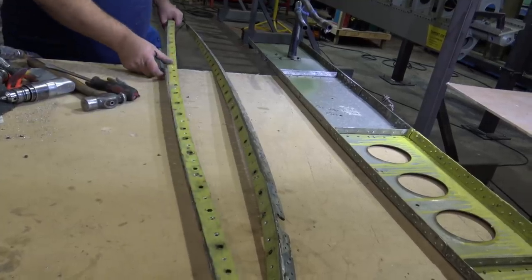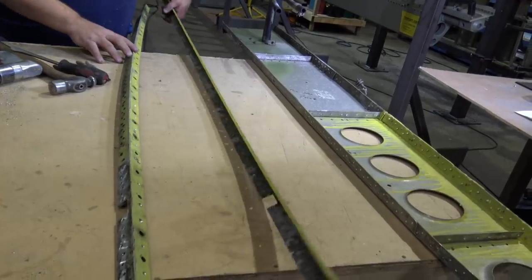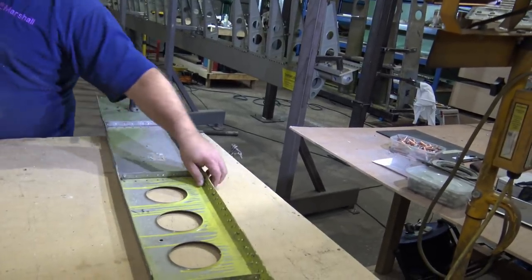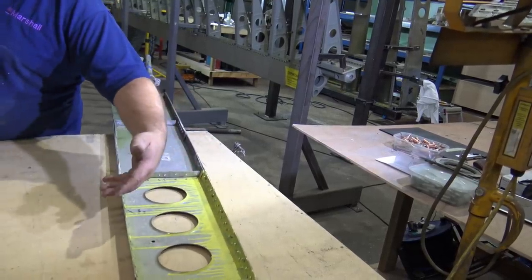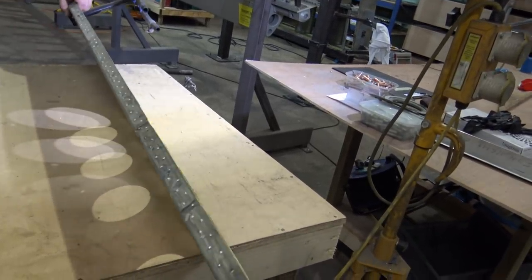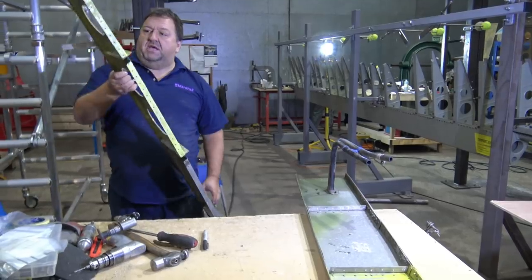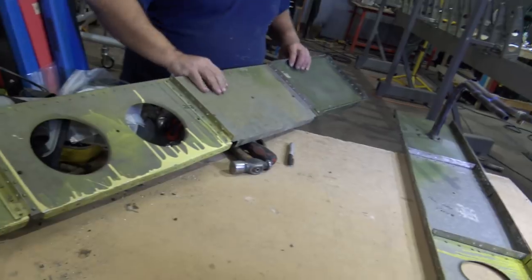This is going to be sent away — it's no good, it's too ravaged. We'll send it away and get rolling extrusions of this, both parts. This is going to be paint stripped, cleaned up, sent away — we're just working our way through. This is the forward spar. All the rivets where we took the heads off to get the skins off — we're getting all the rivets out, paint stripping them. Bob will assess what damage and corrosion there is. This one here has passed the test — all the angles are all right, no corrosion.